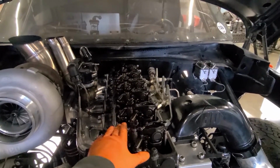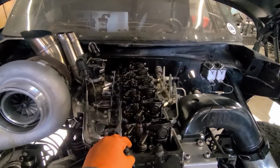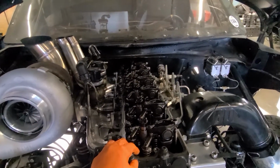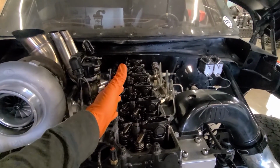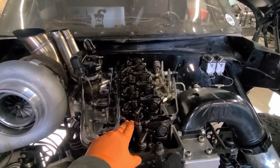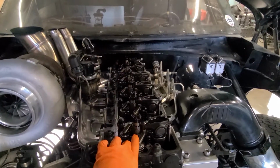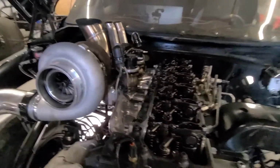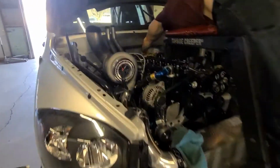Like I said, on Jordan Merciel's truck, we had the same problem, went down, truck was a turd. You could put all the fuel in it you wanted, just absolute turd. Put injectors in it that Milliken gave us from his old car that he had laying in a box. Same problem. All the fuel in the world, nitrous, didn't matter. It was like 650s at best, which is ridiculous. That truck weighs nothing. Put a good set of 5.9 body injectors in it, problem solved.